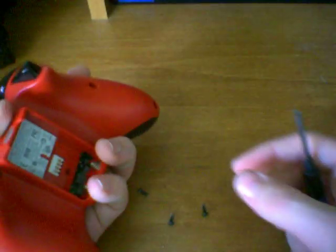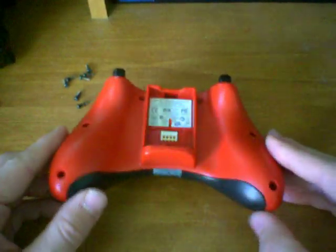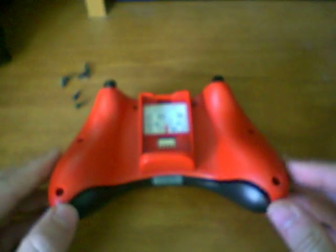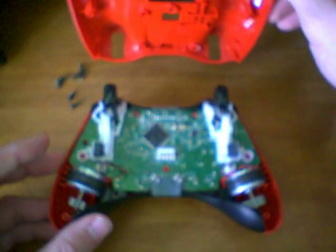Taking off the middle screw is last. After we take out this middle screw, we're going to keep the buttons facing downward. Now we have all of our screws out — let's put these off to the side so we don't lose them. We're going to pinch from the bottom, get your fingernail underneath the sides, and lift upwards. That's going to keep you from messing up the triggers and it's going to release the tension on the spring. Peel up from the bottom to the top — if we went backwards we might get snagged on the triggers. And there's the back shell for the Xbox 360 controller.